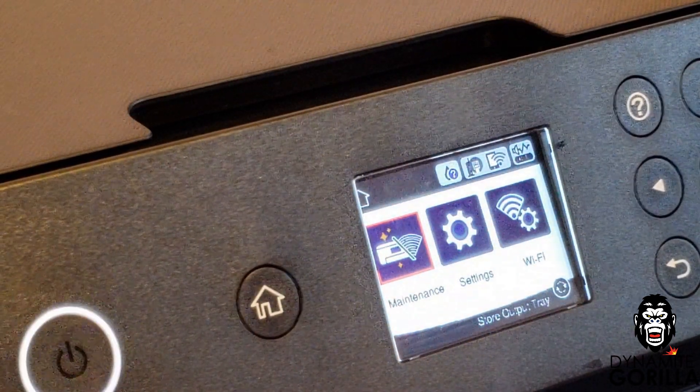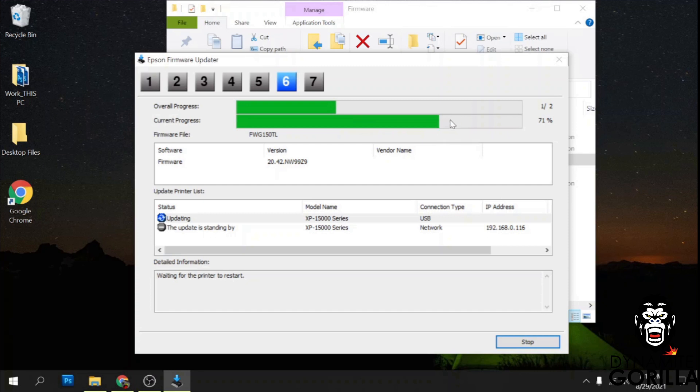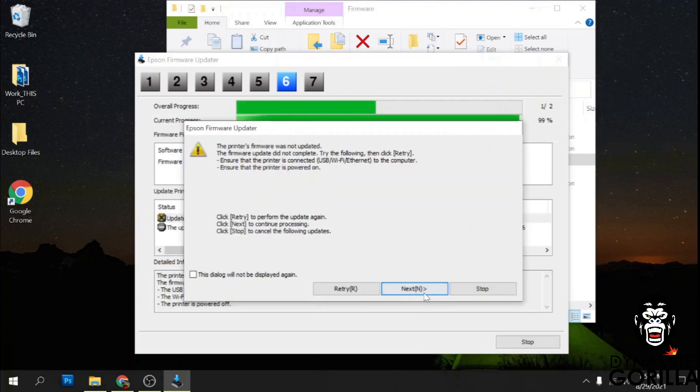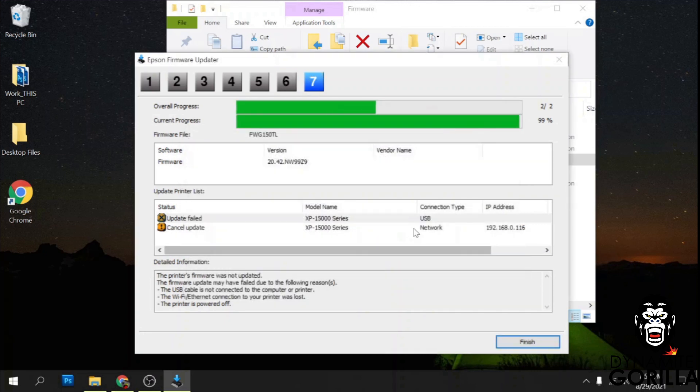Click yes. Off-screen, the printer is going to switch from the maintenance screen and start the firmware update. It will restart, come back on, and then appear to hang from 85 to 99 percent — it looks like it's not going to do anything, then it will stop. Once it gets to 99 it's going to tell you the printer's firmware was not updated — you'll think it failed but it's actually fine, as long as the printer restarted and got back to that screen asking to install the cartridges correctly and the power button is blinking. Click stop, confirm cancellation by clicking OK, then click finish.